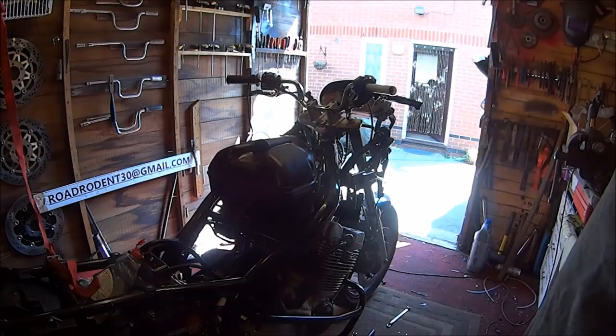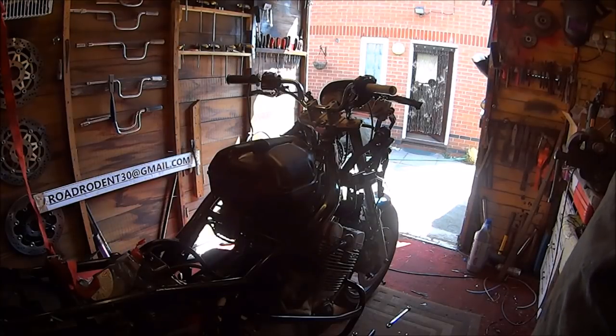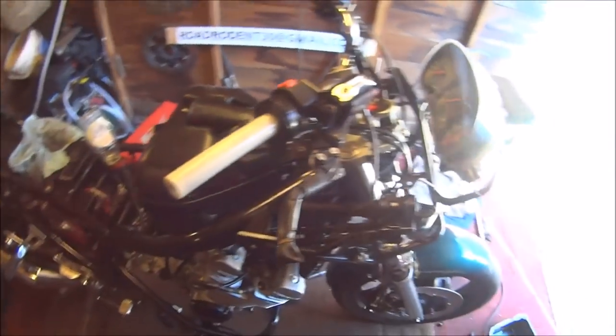Yes, we're not out of the water yet. Carburetors are leaking and it's a bit of a flat spot when you rev it up. You know, it's a bit of a non-response when you first rev it. So that means I'm going to take the carburetors off again. But it does sound nice when it revs up, doesn't it? It's pretty good. Just some more fettling. Now I'm at the end of the project, I'm getting all the subscribers. Can you believe that?